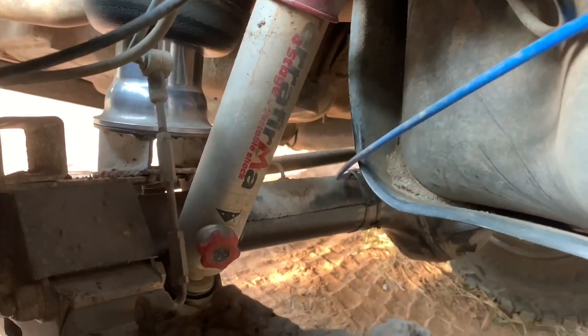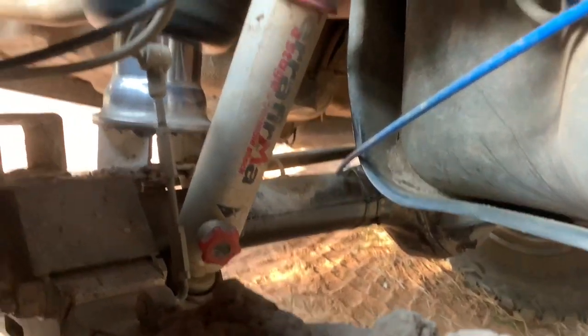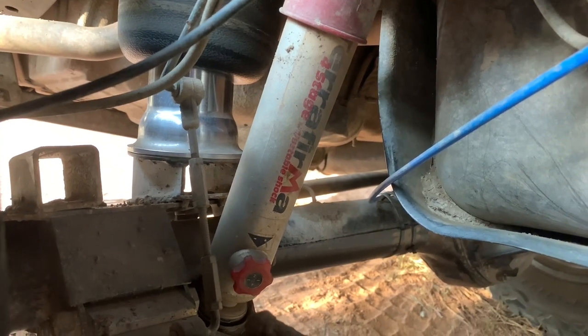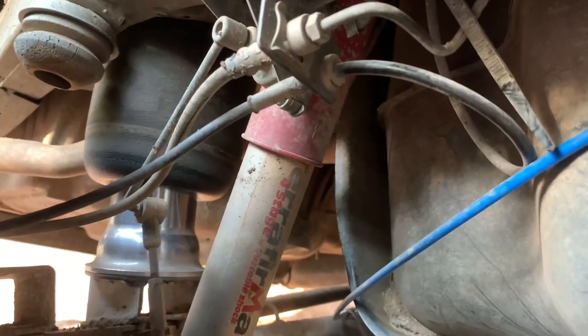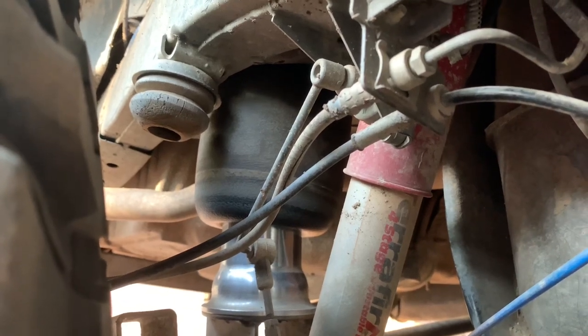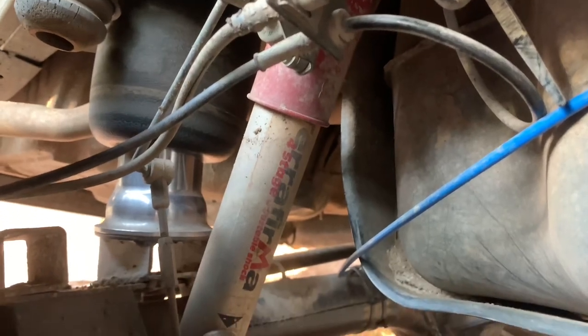There's another good chance there to have a look at the spacer, the bump stop, the height sensor, and the shock absorber. So it's very simple, guys. You can see that forward lean on it. That's all you need. And that'll keep the angle on those airbags quite happy, and it'll allow you to run the standard bump stop still. So there's not a lot to it, guys.